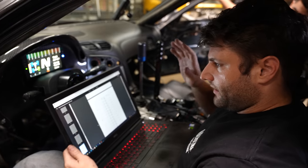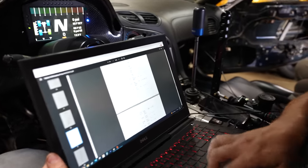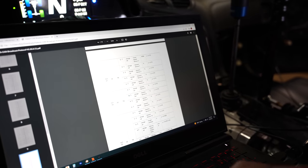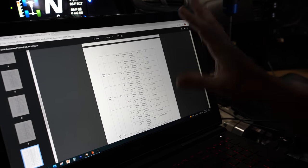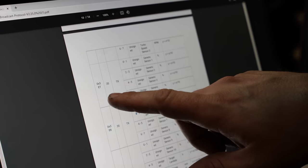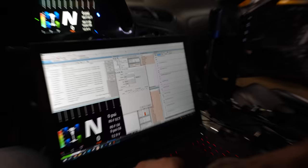But if you look up Haltech CAN protocol version whatever, this is the sort of chaos that you'll get used to. But this is actually the information I need badly. For those of you who are not familiar with CAN bus, it is very intimidating to start, but from a computer background, it actually makes a lot of sense. Right here, I know that my all-wheel drive sensor is one of these three generic sensors. I'm gonna have to go to this base of 0x3E7. So you don't have to get too crazy into it, but we're gonna go to that base.